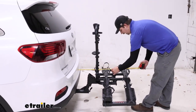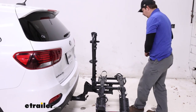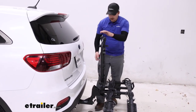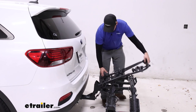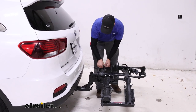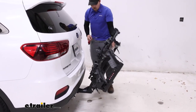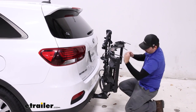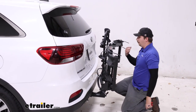The overall distance added to the back is just under 30 inches — about 29 and three-quarters. If you want to leave it in the hitch between rides with bikes unloaded, you can fold it up to save space. Come to the mast, pull off the straps, pop open the handles, fold down the mast, re-engage the handles and straps, then remove the pin and retaining clip, fold the rack upright, and re-secure the pin. Now it's only sticking out about 13 inches.